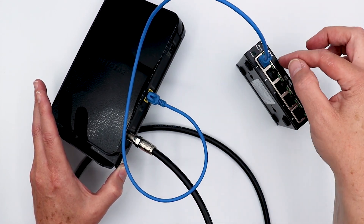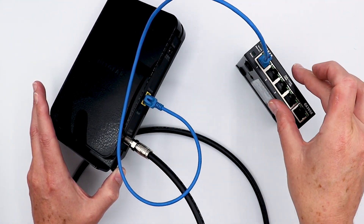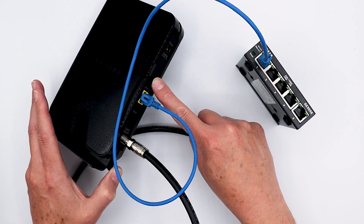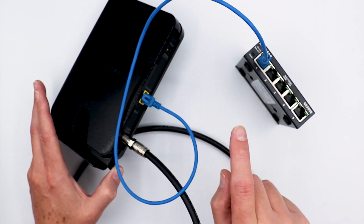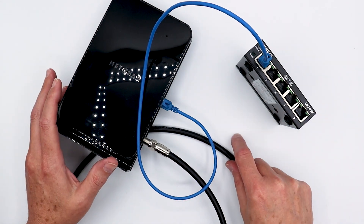Now this port here is being used to connect into this switch, so you've basically daisy-chained one switch to another switch. If you still have three more switch ports available back on the all-in-one, you can use those as well. So now you've got three ports you can use back there and another four ports you can use right here on the external switch. That's the second way you might see this done in a typical home situation.